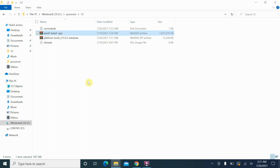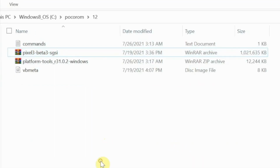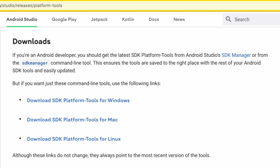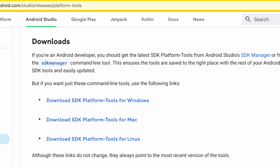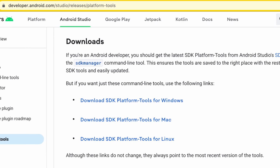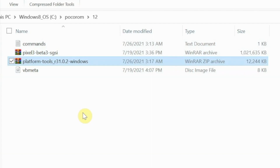Let us talk about what are the files which you need. All the files which you need are linked in the description of the video. The first file is commands, so this has all the commands which are needed. The second file here is your Android 12 GSI, and this is from the Pixel 3. Do note this is an archive and does need to be extracted. Next up, you do need the Adb and Fastboot. Again, I do recommend you download it from the official Android developers website. Also an archive file which will need to be extracted, and then you also need a VB meta image file.